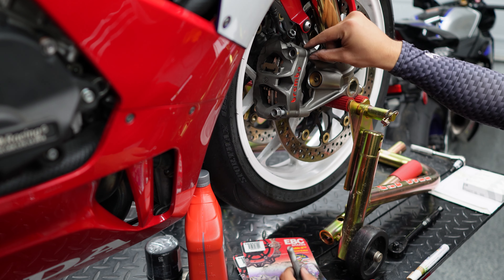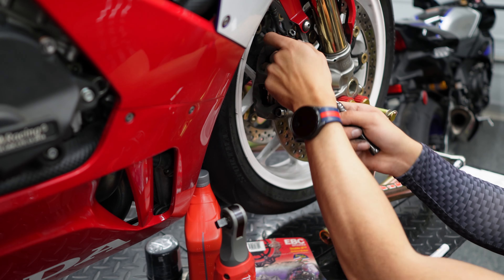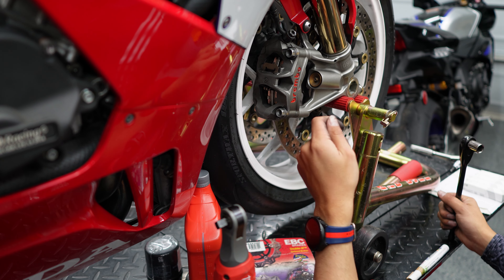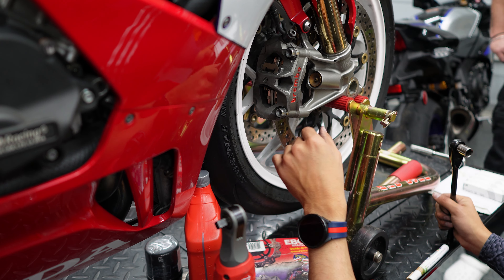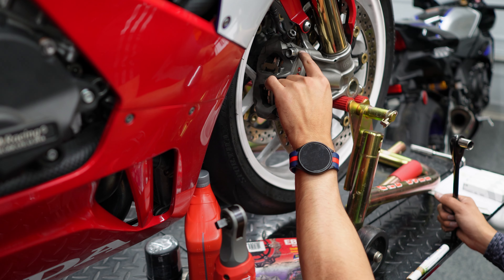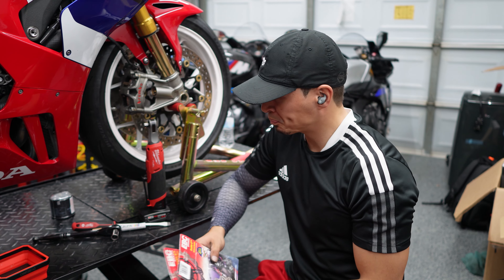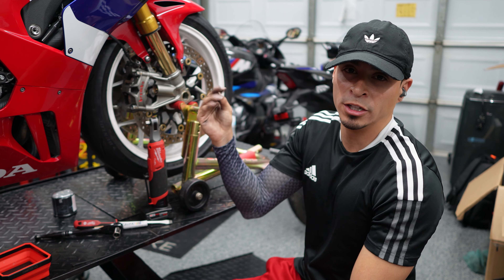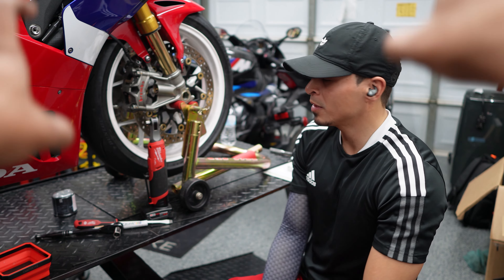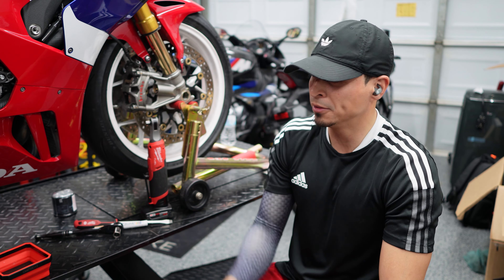Other bikes have little retaining pieces — two lines sort of thing. What I do — and this is the lazy way — is before I remove anything, since it came from factory, I make marks on the bolts with a marker, so I just go back and line up the marks when reinstalling. The torque is probably around 60 foot-pounds or so. Both sets of brake pads are on, we pumped the brake so the pads are touching the rotor — Full Red can go do a wheelie and still stop.